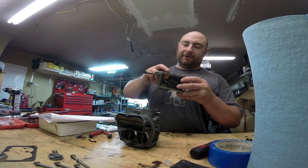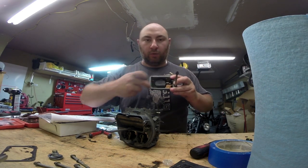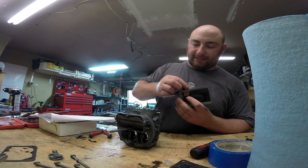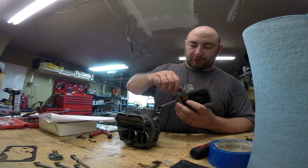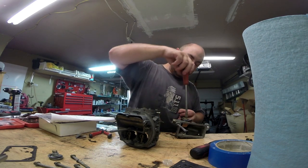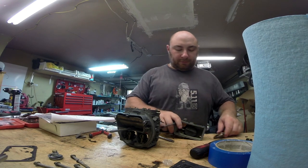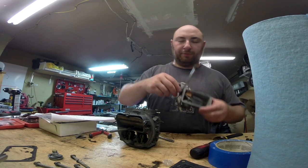In order to figure out how far this needs to be turned in, what you do is flip the float bowl over. You can see this is parallel with the bottom of the float bowl, and you can adjust the screw up and down — just make sure that when you're done, this is parallel. At that point you can just lay down the gasket, lay down the little lock nut, and insert our little screw. Then tighten the screw while holding the lock nut in place so you don't accidentally adjust the float. Now that that's all closed, if we flip it back over it's perfectly parallel. Part one of rebuilding the bowl is fit.